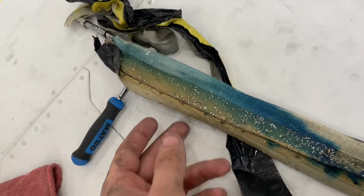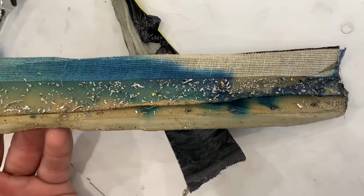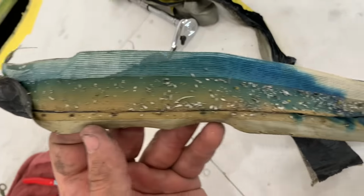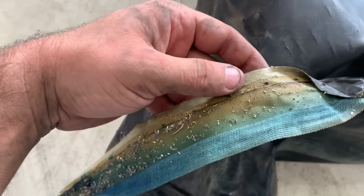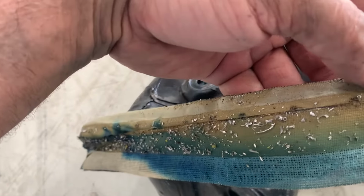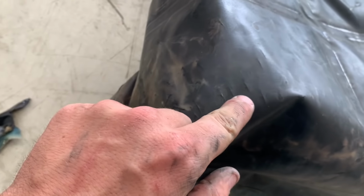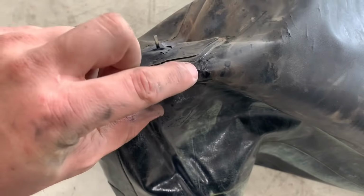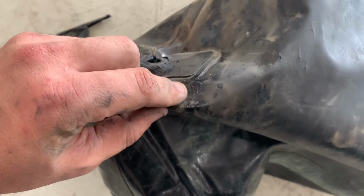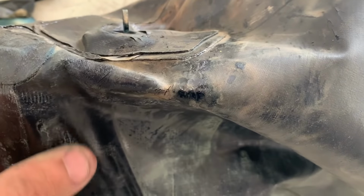So this is the same panel that was glued down. I'm taking the tape up. Look at that. All right, so this piece of tape would have been like this, hitting the tank, but the tape, obviously stuff got around it, because it's not very sticky, because it's old. And you can see in the fuel bladder all the abrasion marks. That's where it was leaking there. You see where it got all scratched up from all the metal that's in the tank.